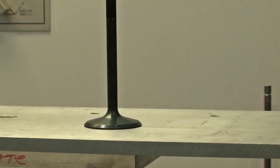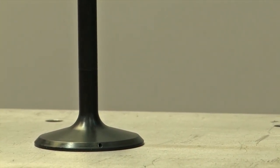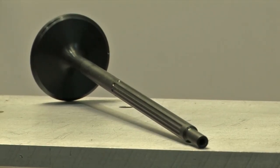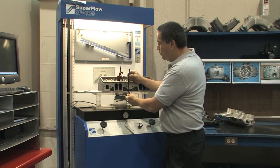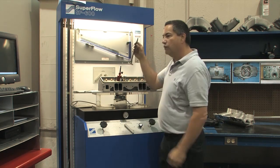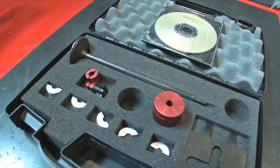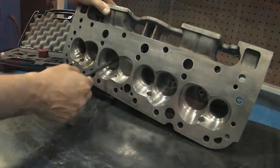We'll take a valve here — he'll be our probe. What we've done is the valve itself is the probe. There's a hole down the center of the valve and a hole all the way out to the valve seat face. We no longer are sticking the probe in the port — the probe is the valve. Setting up the system is relatively straightforward, and everything you need except for the flow bench is included in the kit.